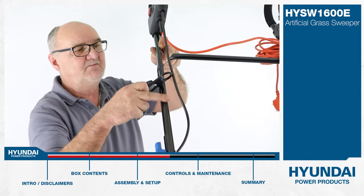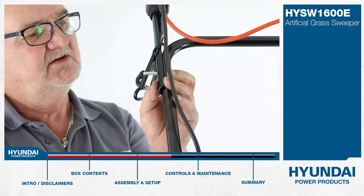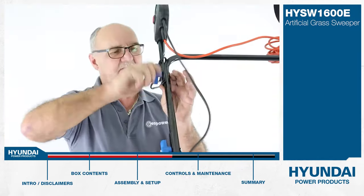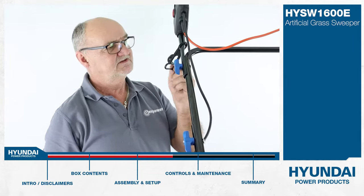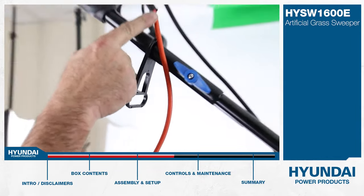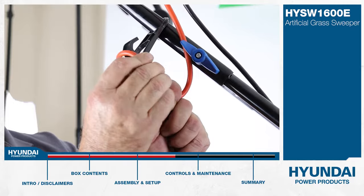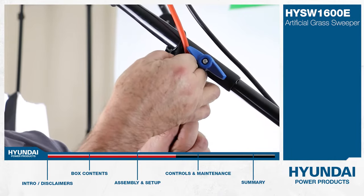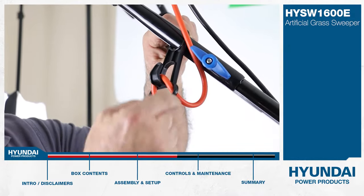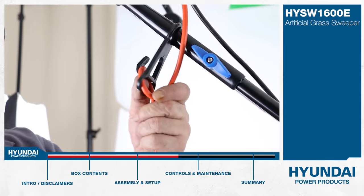I'm just going to take this plastic clip, slide it up onto the handle, and line it back up — taking care not to trap any cables. Put the last bolt in and tighten up the final hand wheel. This unit here is a cable tidy. If you get the cable caught on anything, it's not going to pull the cable out of the controller. Take a loop of this cable, feed it through that lower wide loop, put it over the hook, and just pull it down — that relieves the strain. Any pull is now pulling on the wire itself, which is far stronger than the connection at the top. So that's the cable nice and tidy, and the strain will be relieved.